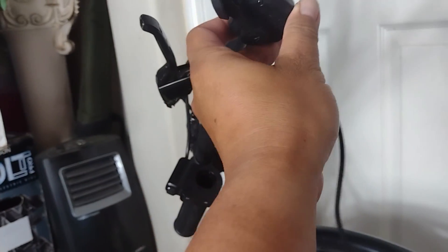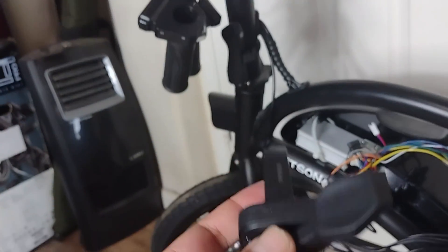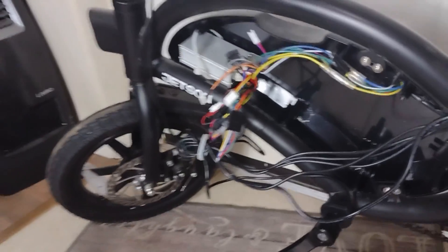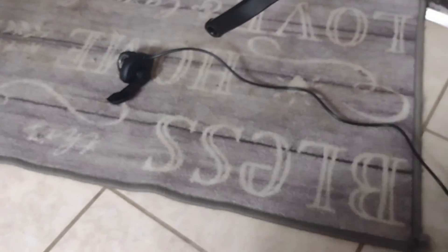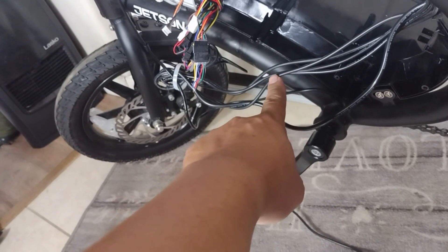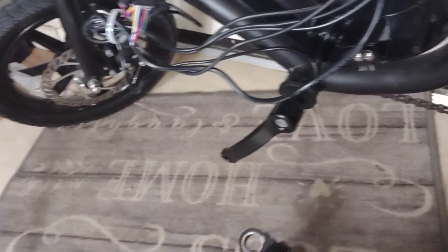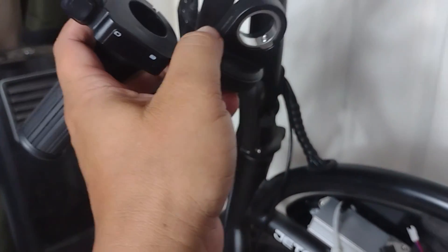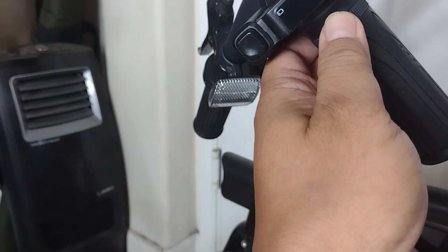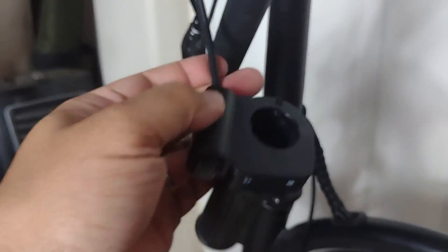It has the wrong orientation for the handlebar, but I'm just gonna make it work. Looking at a video by Shiva on YouTube, he opened this part up to find the connections and color coding. But my problem is the wire I have is not long enough to route all the way through. Since the throttle is the only thing not working — the power and cruise control are fine — I'm just gonna tap into the three wires for the throttle.